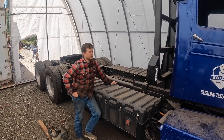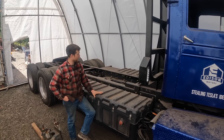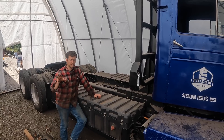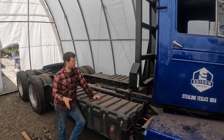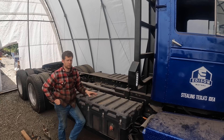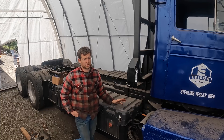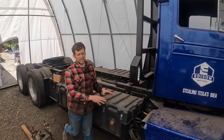Carl is our proof of concept and it really allowed us to test the generator charger, how the generator feeds the batteries, how the batteries feed the electric motor, how all that works together, how we did our control system. Some of the issues we had with Carl were heating issues with the batteries. When running the generator under full load, everything was getting warm, and the problem is we just used the one truck rad for the generator, batteries, and all that. We thought it'd be enough, but the coolant levels didn't quite line up.